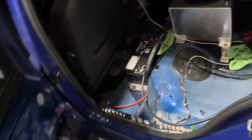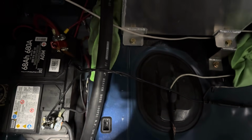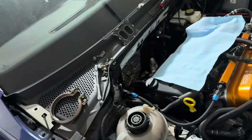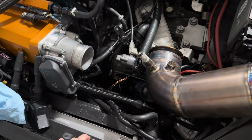As far as the air-water, or the water system in general, everything's working great here. It's about 2 gallons of water, and then the rest is ice. So whatever the capacity of that is, it's around 16 to 20 pounds of ice. But I'm gonna change up the fluid that I'm putting in it. I'm gonna switch to a non-glycol race coolant. It's technically for snowmobiles or icy conditions, for coolant, not on the engine side, but on the air-to-water side. So switch to a more traditional coolant instead of water, and then start running dry ice instead of ice.